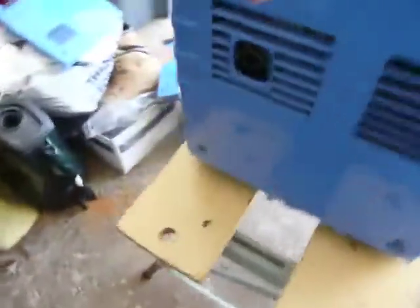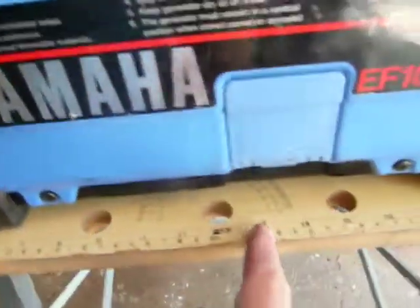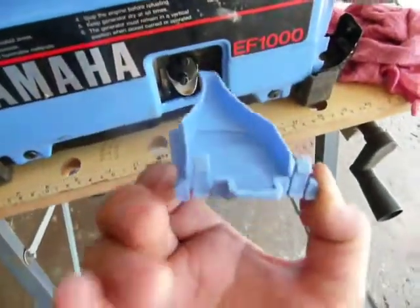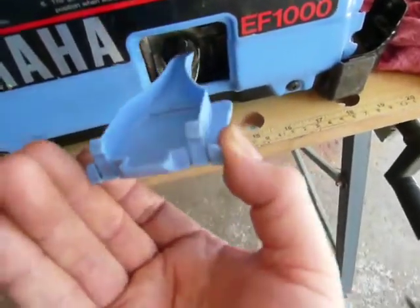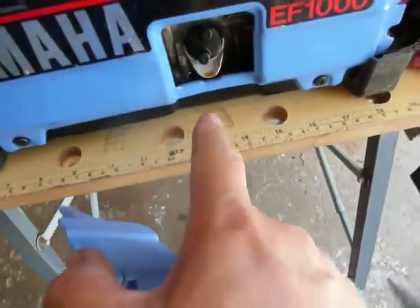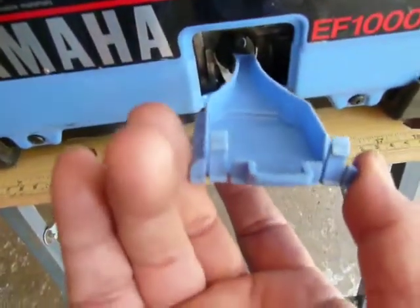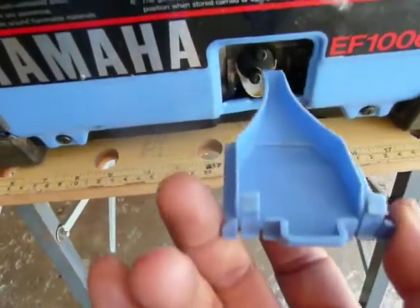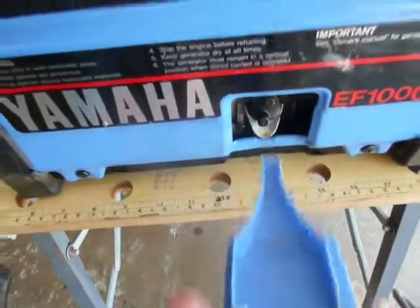Here is the muffler exhaust, and there are a few plugs here. This is the engine oil fill funnel. You unscrew the plug and basically just add oil until it overflows — that's the right amount. You can put the funnel here and add engine oil. I was going to change the oil once I fix the surging problem.